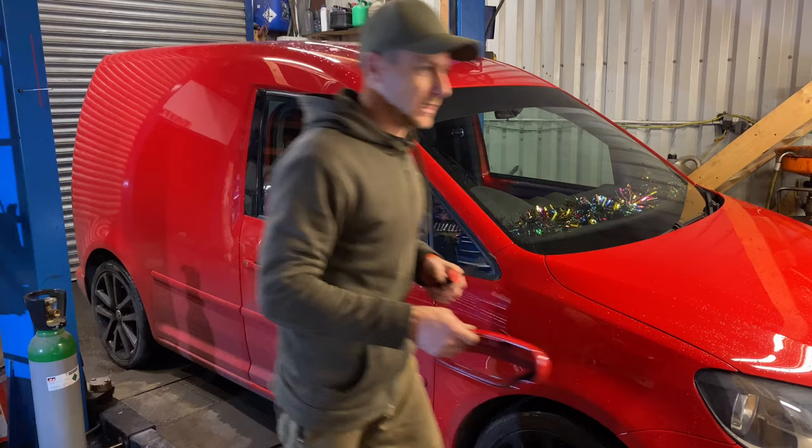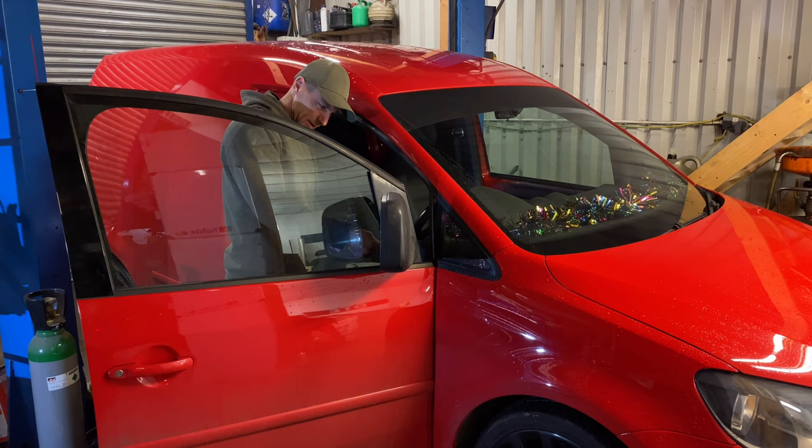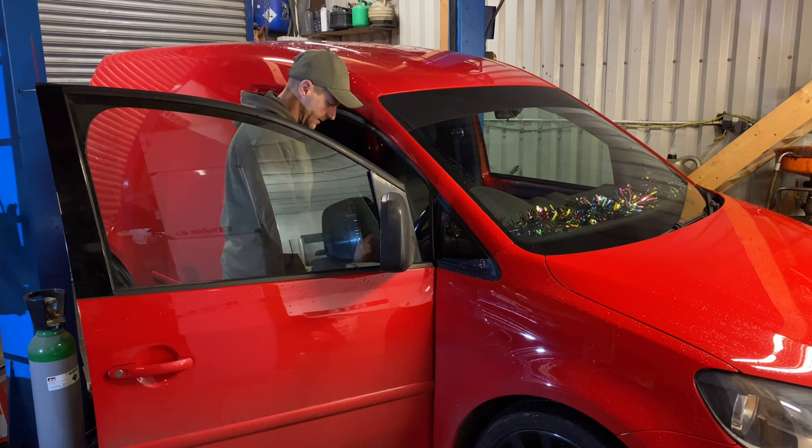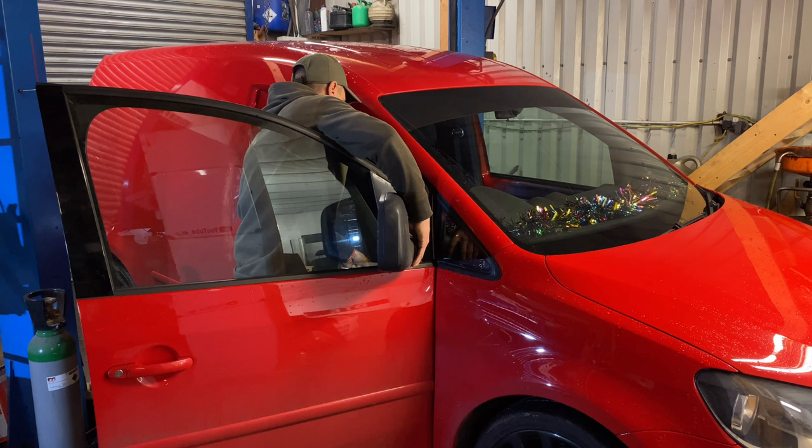The door card's already off and someone has already cut the wire on this wing mirror, so I haven't got to unplug it - nice and easy. It might be a pain to drop the bolts inside the door and get them out. There are meant to be three bolts but there's only two on it - easier for stripping apart but I'll find them to go back in.